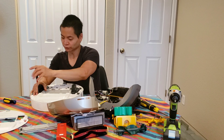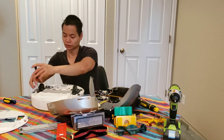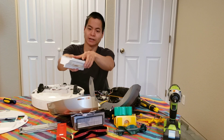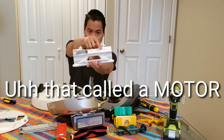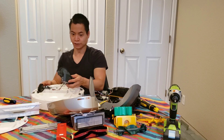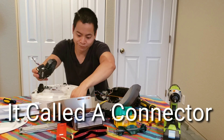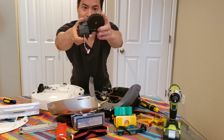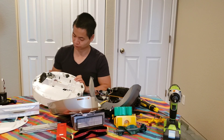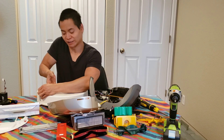Just a couple more screws and I should have the extractor out of the Roborock. One thing to note is on the Roborock S5 I did note that they made the wiring a little bit easier — with this you have a few connectors to remove the left and right wheels. There's the extractor module, drive wheel, basic pin connector right there, nothing too fancy. Here's one of the wheels, held on by a clip. You can do the same thing with the side brush motor as well. Let's see if I can just get the top off so you guys can have a quick look inside. Kids, don't try this at home — I am a professional.